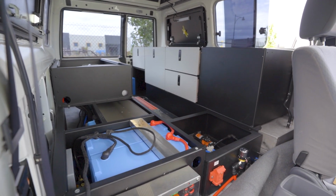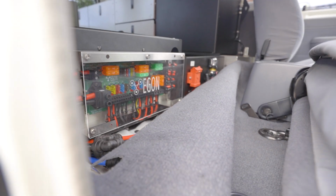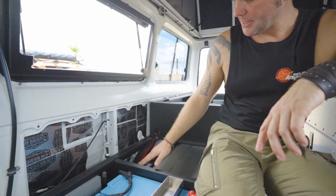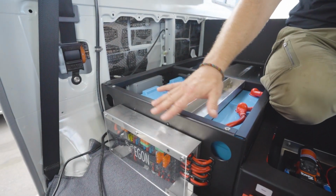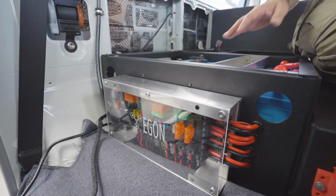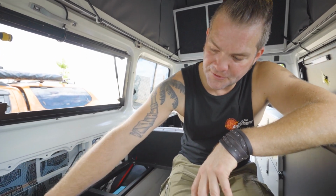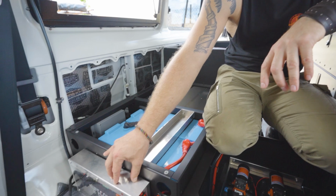The compressor connects to the DC hub. The 12 volt side of the water heater connects into the DC hub. The Victron 20 amp solar regulator connects in here, and then all the other bits and pieces, the charge points, the fridge, the roof lights that I haven't talked about yet. Everything interconnects here in this one unit, which makes it really easy if you ever have to do fault finding, and all the fuses are integrated into this unit as well.